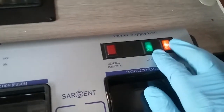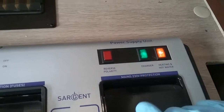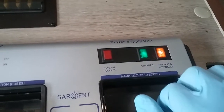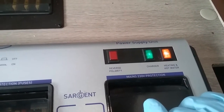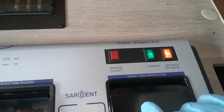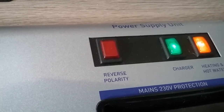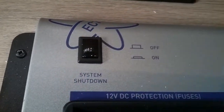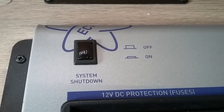We then have the mains trip switches just here — we have the three individual MCBs, main RCD and test button just here, again numbered up and corresponding in the Auto Sleeper handbook. Two isolator switches just here for components that use mains electricity. The amber one is for the Truma heating, hot water and air conditioning — if you turn this off and you're trying to run anything on mains supply you will get the error code; it can be left on, it's more for maintenance. The green one is for the battery charger — again best left alone. This one here will illuminate if we have reverse polarity connected, which can sometimes be found on some continental sites. Full system shutdown just here — if you're not going to use the motorhome for a prolonged period you can press the button to kill any residual draw on the leisure battery, which is extremely handy in the winter months when there isn't a great deal of UV light hitting the solar panel.